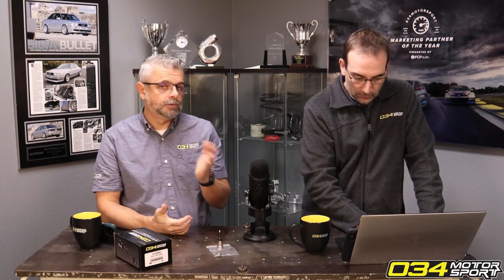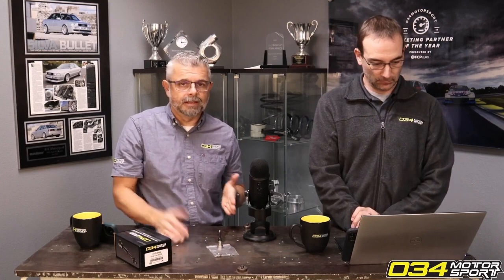On the Stage 1 Plus and Stage 2 Plus files, the reason an upgrade is needed is that the factory fuel pump is driven by the camshaft, so the fuel pump flow curve is closely linked to camshaft speed. At lower RPMs the high-pressure fuel pump flows quite a bit less than it does at higher RPMs. The problem is that the torque peak in these motors is in the 3,000 RPM range, so at the point in the power band where fuel demand is highest, the factory pump flows less than the engine's potential. It's very closely linked to the VE curve of the motor.